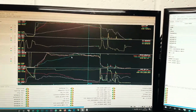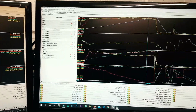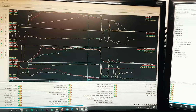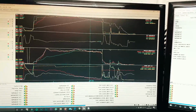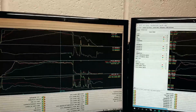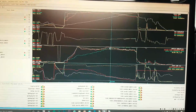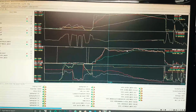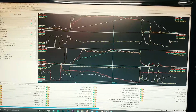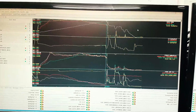I mean, we can pull up the ECU data and the calibration and show you the differences, but it's purely down to boost and fill, so load target itself. So the boost target is pretty much the same. It's just the fill target, which is what the ECU determines to create the boost based upon its acceleration and torque, is slightly less. And you can probably just see that within the actual boost line there. So the intake manifold and the charge pressure, you'll see it peaks at about 5,500 RPM, and then it slowly reduces the boost, and that is comparative to the actual fill target.